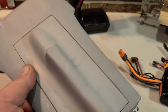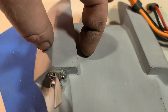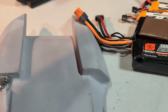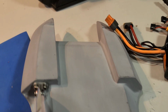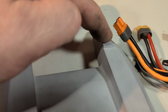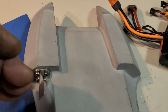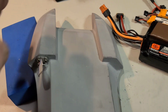Okay, I've sanded the hull, got the ride pads reduced in size. I've probably taken off a 1/4 inch of width, added some non-trip onto the sides here, got both ride pads the same angle. I got the recoveries the same angle. The recoveries on the boat, one was like back here, one was up here. The backs of the sponsons were not identical. Okay, they were rounded. I had some big chips on the corners, and I got everything right in that aspect.